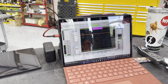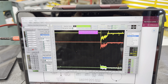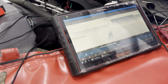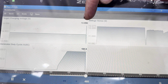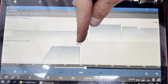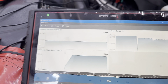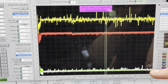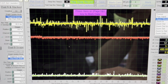I'm going to go ahead and start it. Come on over here and let me show you what we've got on the scanner first. We can see right up here at the top it's trying to charge at 13.896 volts. The sense voltage is 11.8 and the duty cycle on the alternator is 100%. So it should be basically putting out system voltage straight into that field wire. Now let's go look at the scope — our field wires are green and white. Green is at the alternator and white is at the engine module, and we can see that's sitting right on ground. So that is not doing anything — there's no control there.